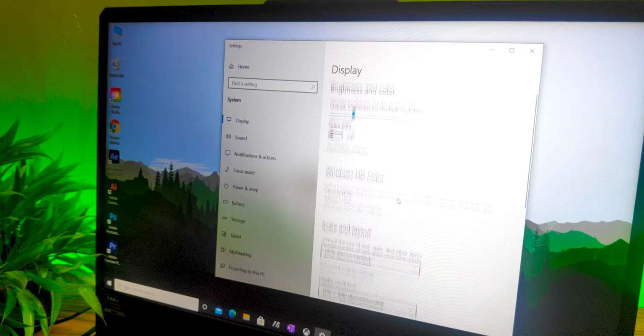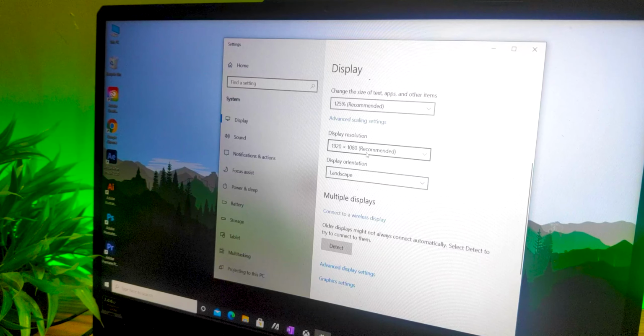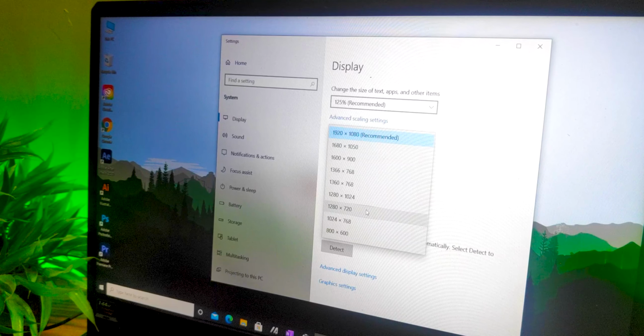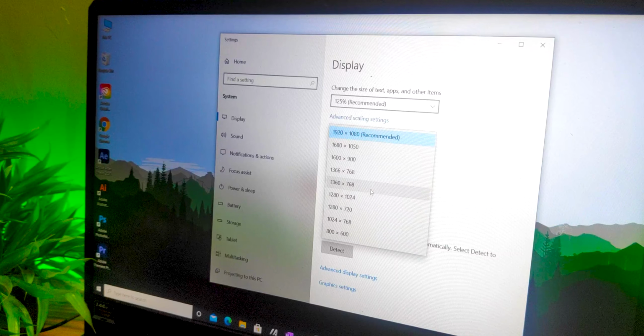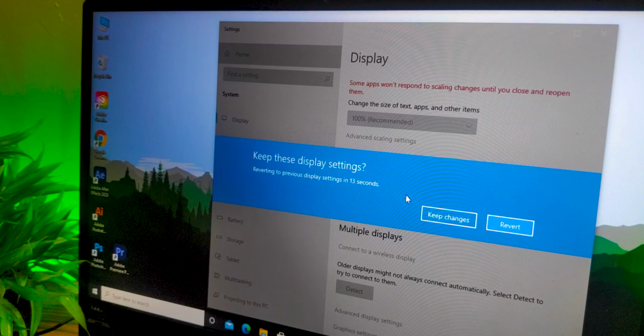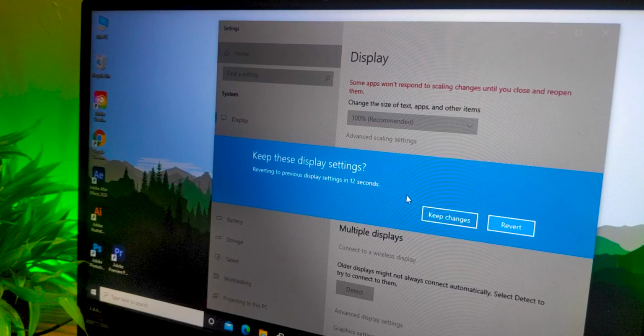So now if it's a 1080p display or a 4K display, now in order for the display to show you a lower resolution image, what it does is, both in an LCD panel or an AMOLED panel, it shows you the same color in more pixels, therefore giving you that pixelated look. So the same amount of pixels are being used when it is even a lower resolution image. So it is not found to be saving any battery life.